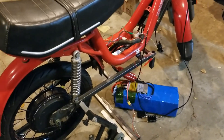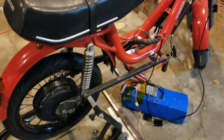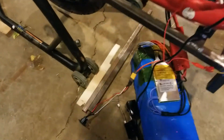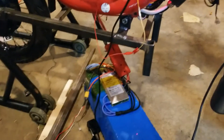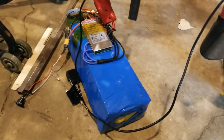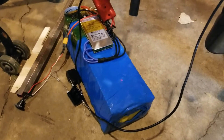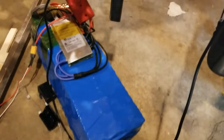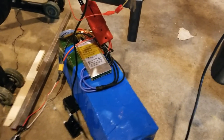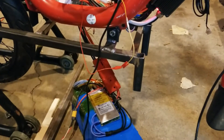You can see I've got kind of half of a subframe done. The wheel's going to be in the back there, obviously. And up front here, here's the battery I made. I've got 200 18650 cells in there and a 300 amp BMS, and I'm going to build a little cage right there that the battery will sit in.